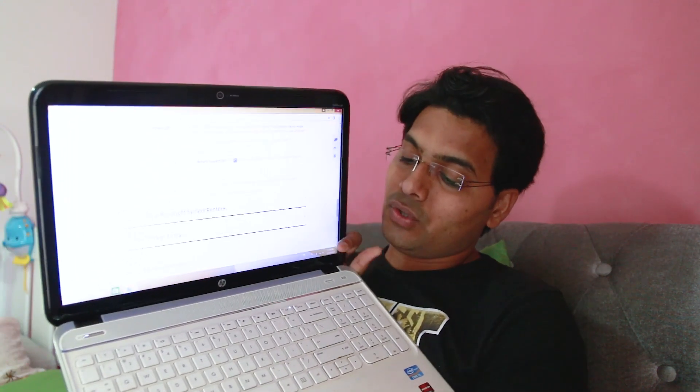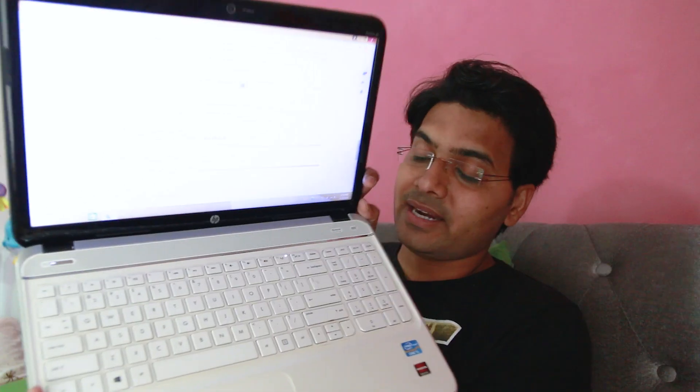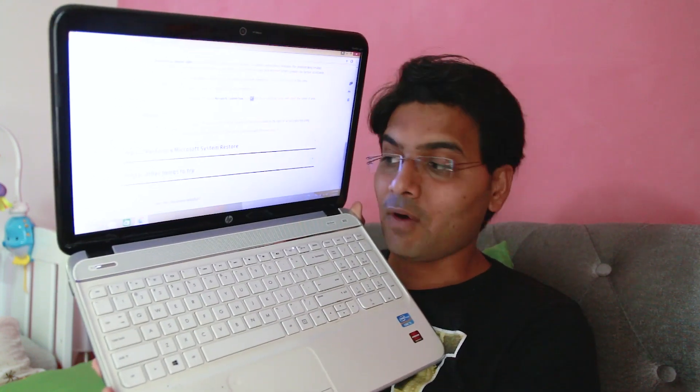After all that, the F12 key — the wireless symbol on the keyboard — was still red. I pressed the Function + F12 key a couple of times and it was not changing from red to white. What I found was there was a hardware issue inside the laptop. I opened the back panel and checked which Wi-Fi card is installed — it is a Ralink RT3290 card.